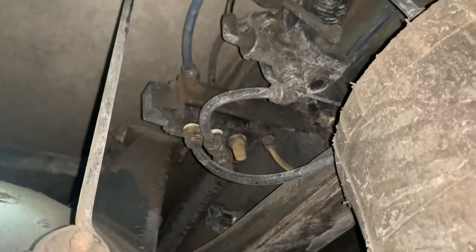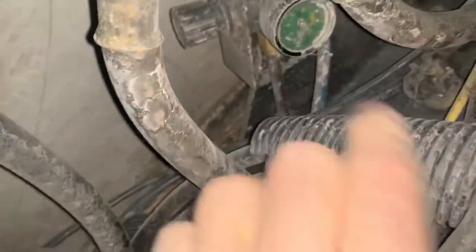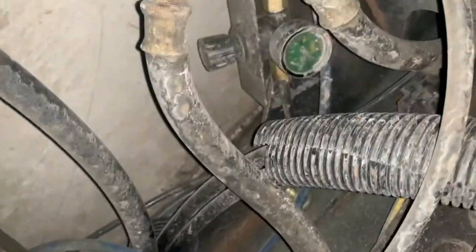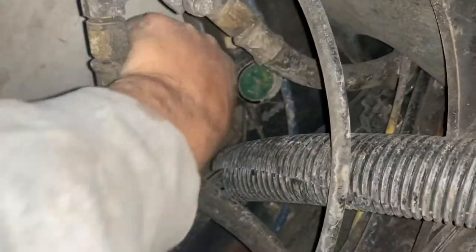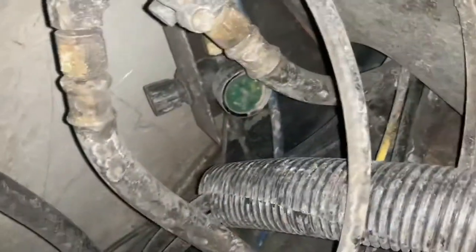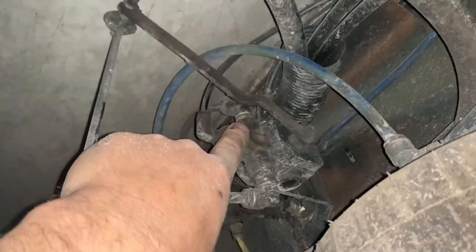Hopefully you can see. Basically what I did was I plugged in a regulator — that's this right here. You're not ever going to get to it, so you don't really need to have it accessible. I can climb under here and adjust the pressure right here, but once you have it adjusted, you're not going to get to it. So I split the supply that normally goes to your auto ride valve.